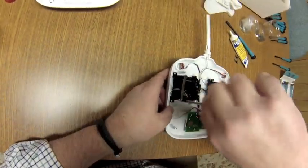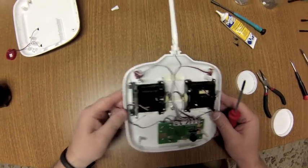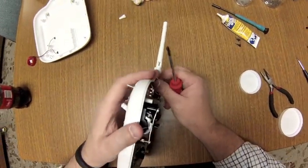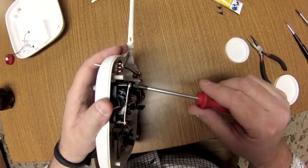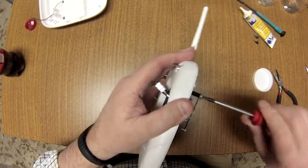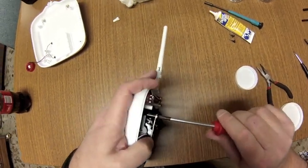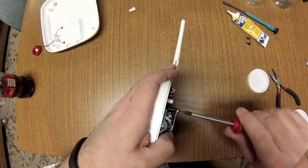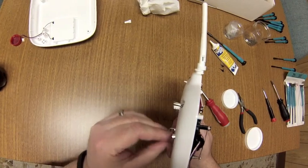Okay, now we're rolling. Wipe some of the grease off my hands. Okay, and here I'm going to adjust the adjuster down just a little bit. I'm going back to the fixed screw, turning that down until it bottoms out. Again, I'm going to be careful here because that's not a heavy duty post that it's mounted on. Okay, and we can check our tension.